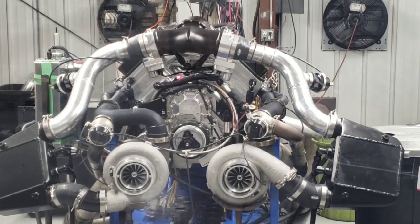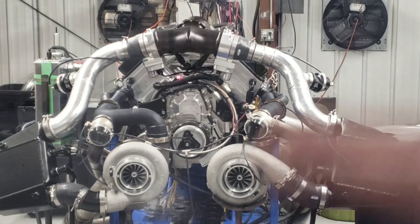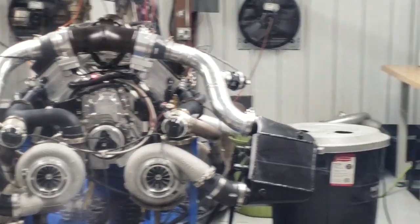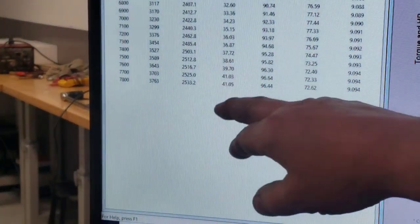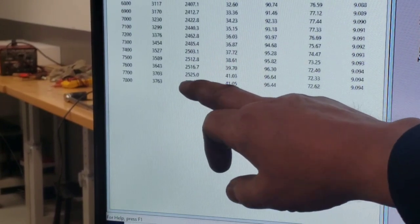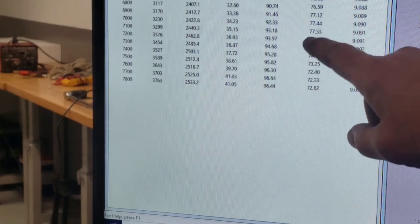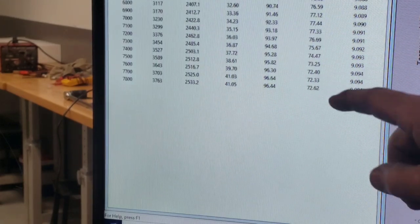What I would call basically 100-to-1 — for every pound of boost, it makes 100 horsepower. So it makes more than that, then it goes to a spot like at 35 pounds of boost where it makes right at that. And then as we continue to go above it, it starts losing so it no longer makes 100 horsepower per pound of boost. Like where we're at 41 pounds of boost, even though we're a little lean through here, it might have made 38.50 or so. But you can see that because it is losing fuel pressure it's going lean, and I pull back on the throttle.